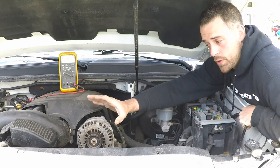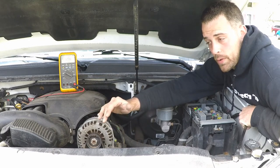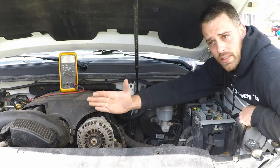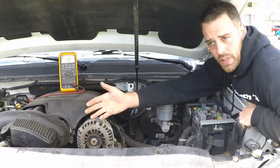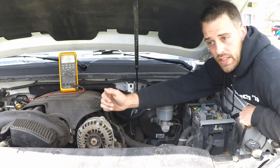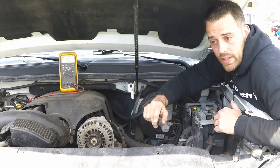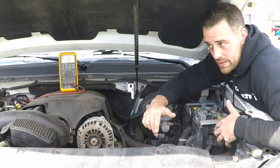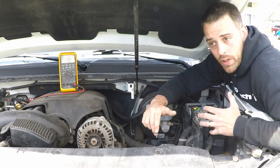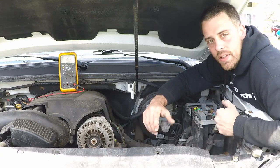So in order to preserve you and your driving on the road, it can actually start shutting things off, like if you have heated seats, it'll start turning off heated seats. They're called load sheds, and they go in different stages. So like stage one will be heated seats, and it might turn off the air conditioning. Stage two gets a bit more aggressive, and it starts turning off things like the blower motor for your heating system. It starts getting rid of things like defogging in the back window in an effort to try and preserve safety, yes, but necessary safety.